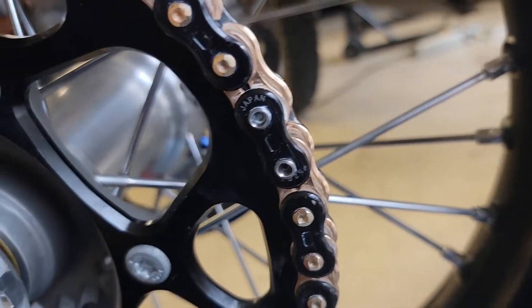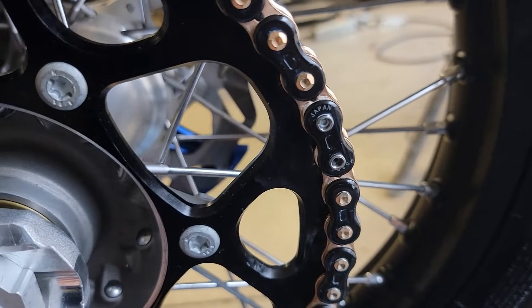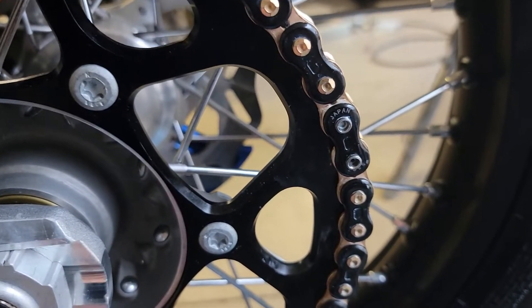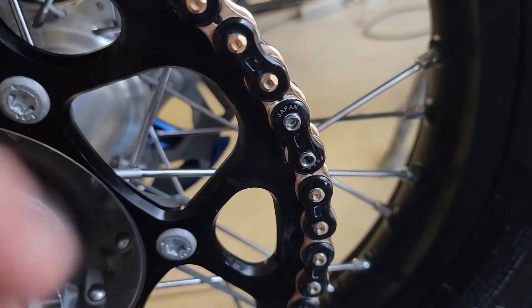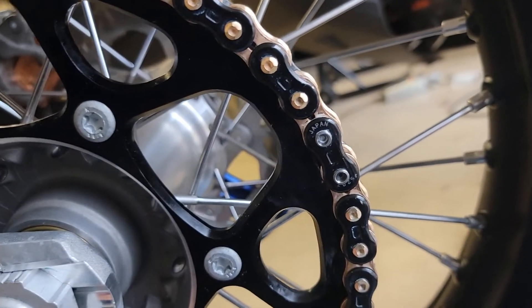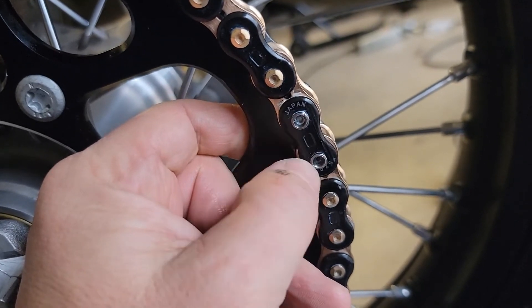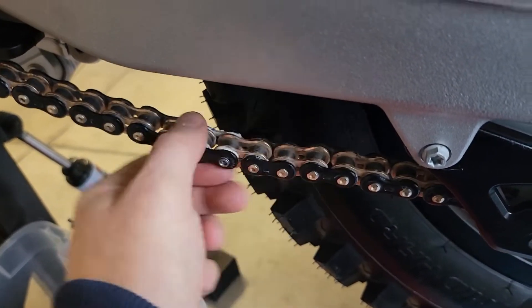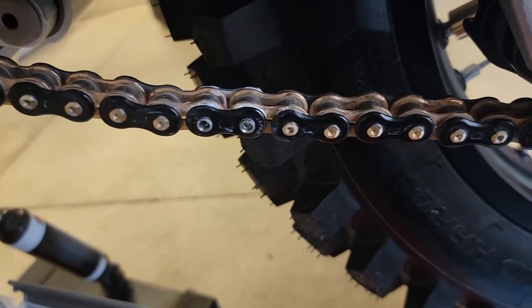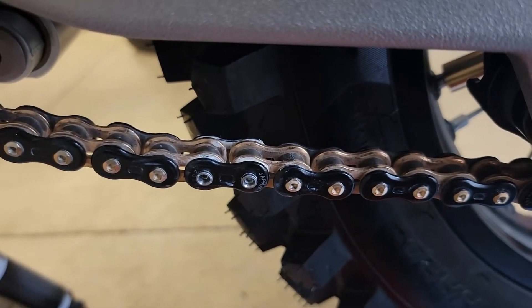With a little patience, I got this rivet on here. You can see they both look fairly symmetrical, and most importantly we didn't tear any of the edges. Truth be told, I had the previous master link fractured when I was spreading the other rivet, and I was barely tightening down. I think what happened is I got some grease in there on the other master link, and the hydraulic pressure when I was driving it in fractured the edge. I debated if I should share it, but I thought I probably should. The next one I made sure to keep grease out of there, went really slow, and got these flared out about 0.5 millimeters, which feels good and there's no binding in the link. The side plates measured out the same, so there's nothing wrong with using a clip. I luckily had an extra rivet master link on hand for this chain.